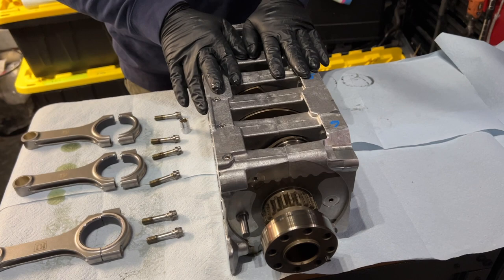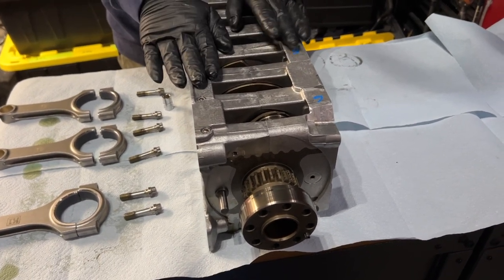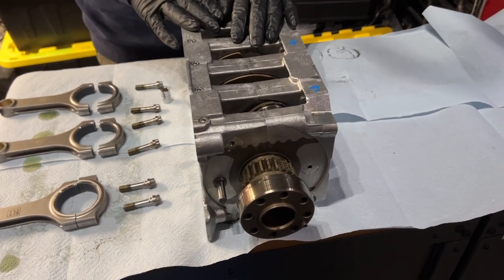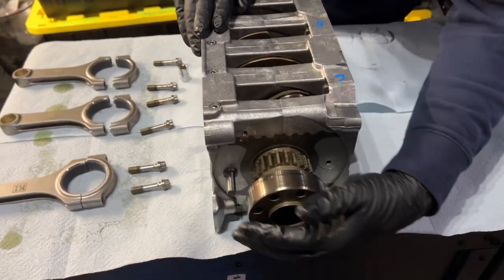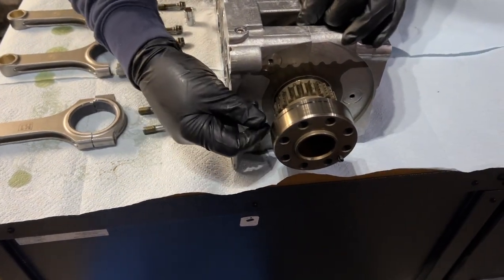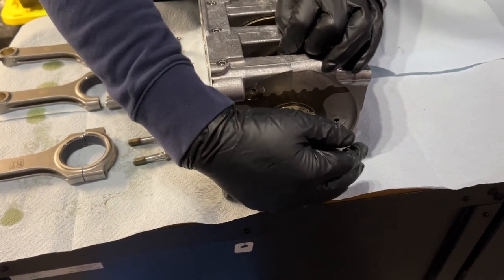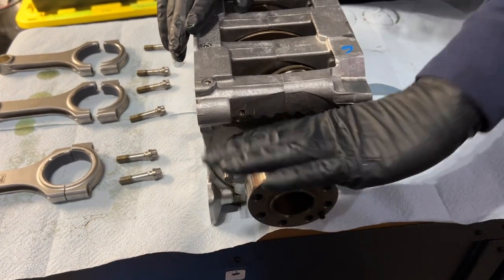to redo this, is having the proper position of the assembly relative to the rods that you're going to put in. So let's see. Keep me honest. This is the IMS chain side. It also is the side that has the pin. It is the side that will connect the flywheel, right? Yes. Am I right so far? Flywheel side, pin side, IMS side.